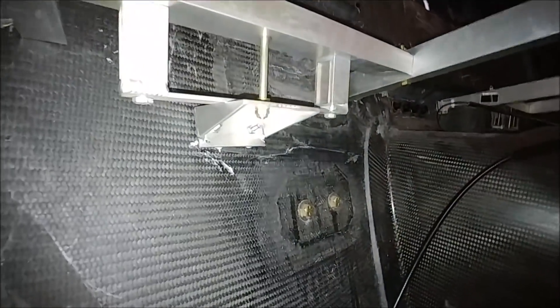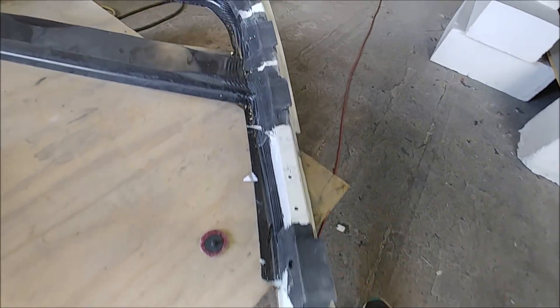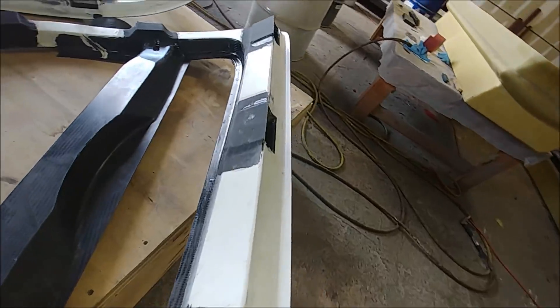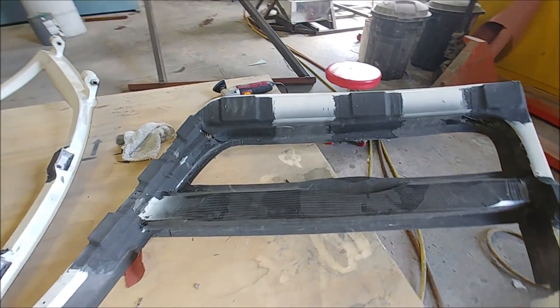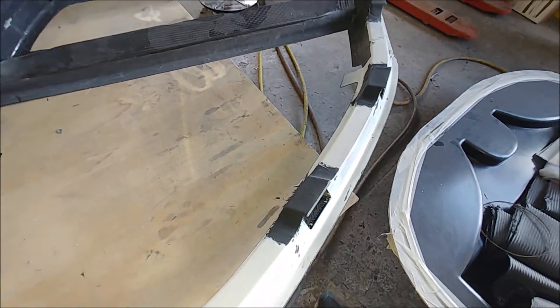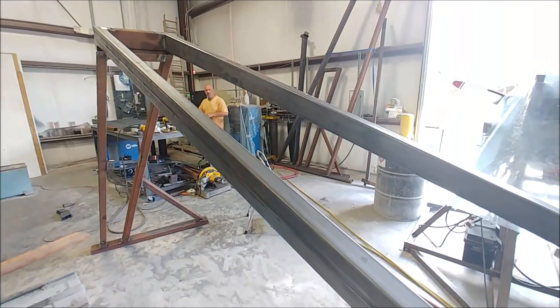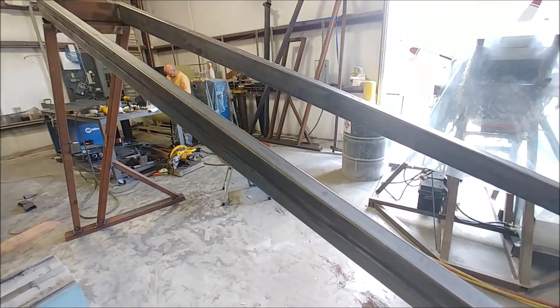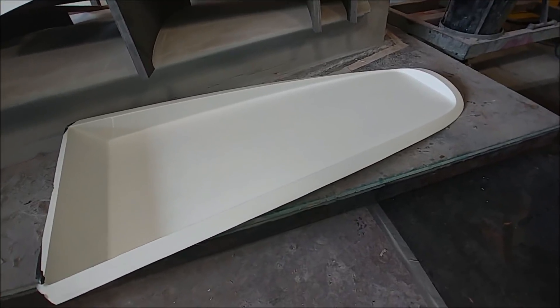You can see we've got both rudder pedal brackets in place and bonded the nut plates onto the forward bulkhead — we'll pull the brackets out and do a layup over all those little studs. Here's the door frame with the peel ply removed; the guys have trimmed off the excess carbon and they're starting to look pretty good. I just need to redraw the holes through that layup for the bolts and recut the little slots. Jim's got the second wing frame together now — the first one is leaning against the wall — and we won't be welding the fixtures on until we're ready to lay up the wing.